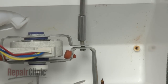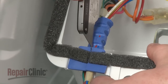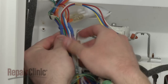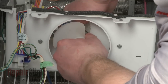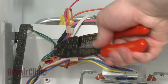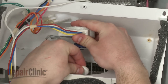Remove the screws securing the mounting bracket and pull the bracket off. If applicable, carefully cut the wire boot open to release the old fan motor wiring. Pull the fan blade off of the motor shaft. Unclip the thermistor from the evaporator and, if applicable, cut the zip tie to release the wires. Pull off the dust cover and remove the old fan motor from the housing.